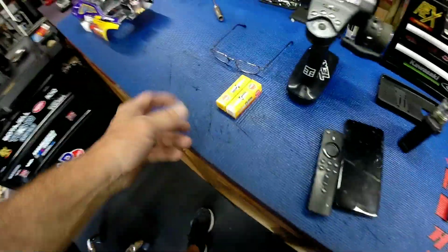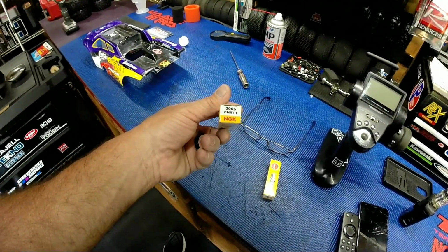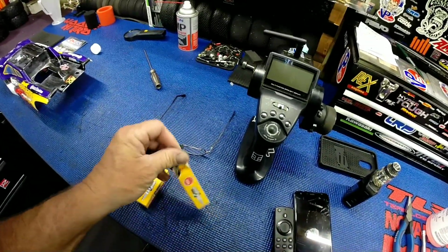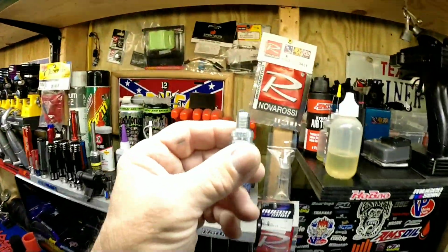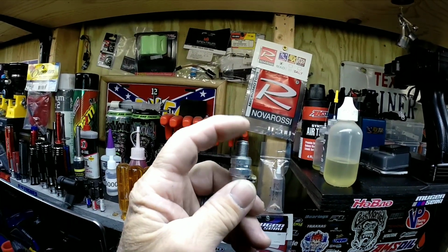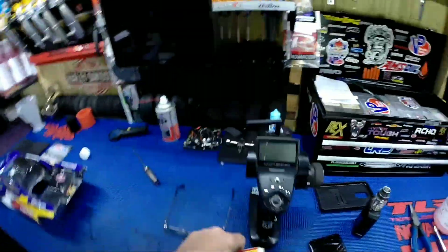Alright guys, so we picked up a couple of NGK spark plugs. Part number on these plugs, so you guys know, is 3066 CMR7H. I replaced one already. Was watching some of Mr. Bodigel's videos, and one where the brand new engine in the Baja was hitting the plug. So I pulled this one out and checked it, and there was no issue of that. No bent. This bar right here, the electrode, well, I guess the electrode's inside, but this piece right here is not bent at all, so we don't have that issue, thank God.